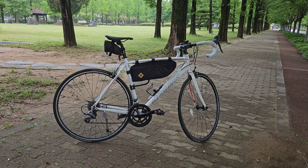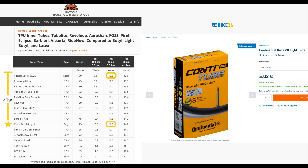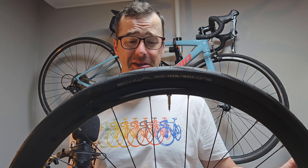To change this, he maxed out his frame clearance with 25mm GP4000 and GP5000 tires running tubes, and he can run these at a reasonable 85 psi, just below the Silca recommendations — a massive upgrade for speed and performance. Even though the bike was very cheap, it feels legitimately impressive now. My wife is much lighter and could be fine with the stock 23mm tires, but much faster 25mm Continental Ultra Sports allow for a plush 70 psi and a lot more grip. Upgrading thick stock tubes with cheap Conti Racelite tubes offers really good improvements and nearly matches more expensive latex and TPU tubes for rolling resistance. The stock tubes can be repurposed as spares, making this an incredibly cost-effective upgrade.